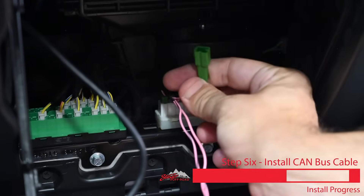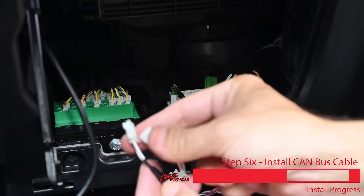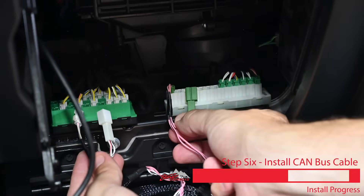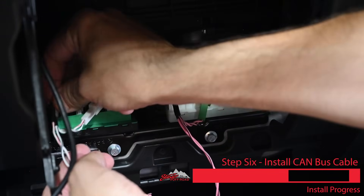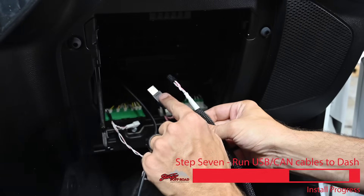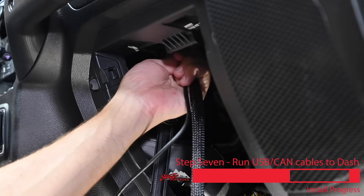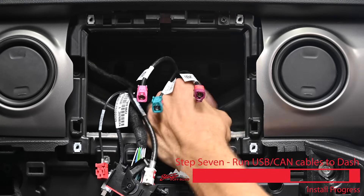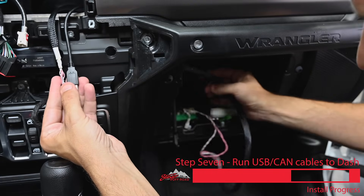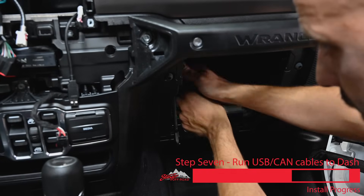There's no factory connector here, so we don't need anything plugged into this T. Notice the connectors on one T are green and on the other T are white — you're going to match and plug the white connectors into the green connectors. Just plug into any available port, and since there is no factory connector we don't have to connect to that T. Now take the USB cable and the CAN wire cable and route them up through the dash behind the factory air vents to where the Stinger module is going to be located. There's not a lot of space inside the dash, so once your wires reach where they need to connect, take the excess wiring and push it back inside the dash.